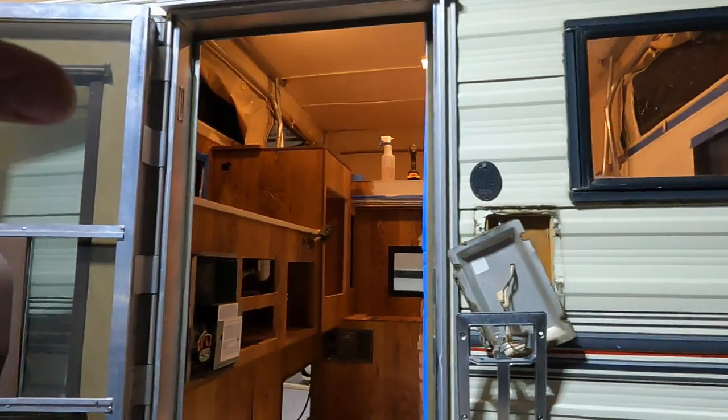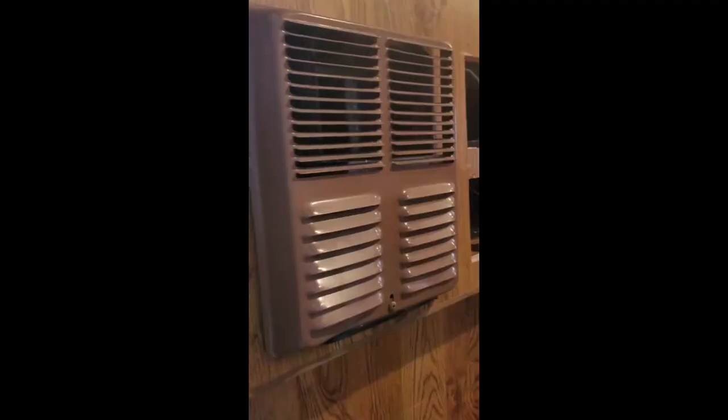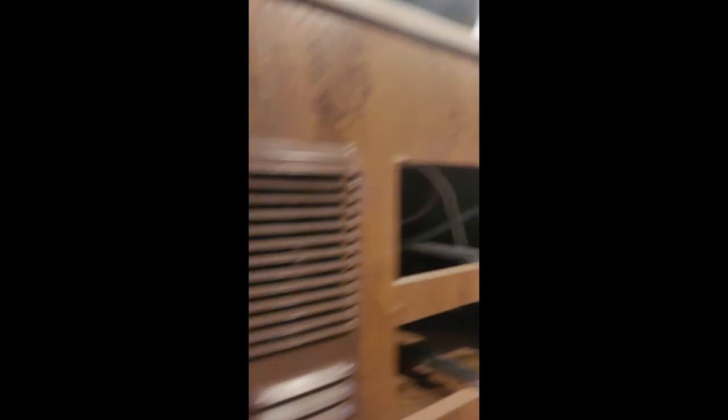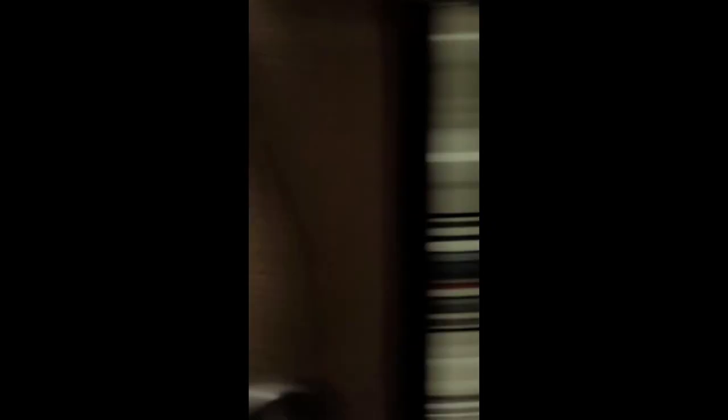So that's what I'm getting into — this is my new project. I plan on doing just a little series of videos showing how I've cleaned it up, what things work, what doesn't work, and how I fix things. The heater wasn't working when I got it — I changed out the blower motor and now it works perfect. We got hot air! Needed a new motor, and now you can't even put your hand near it — it's really hot coming out.